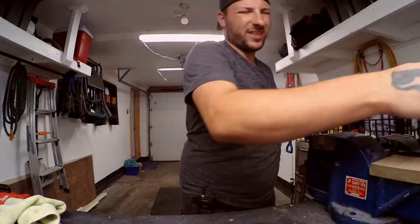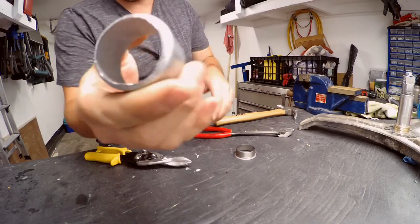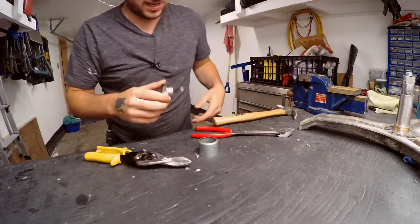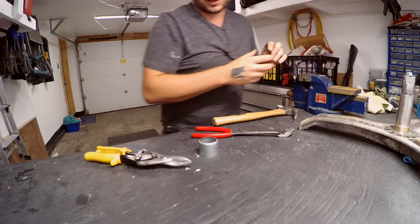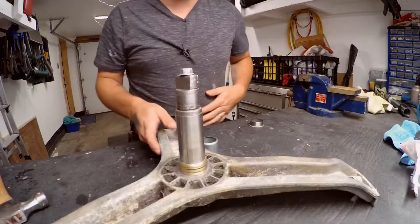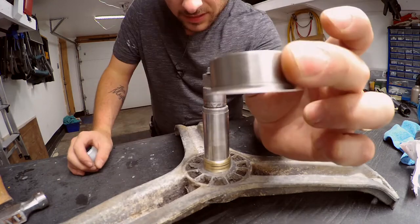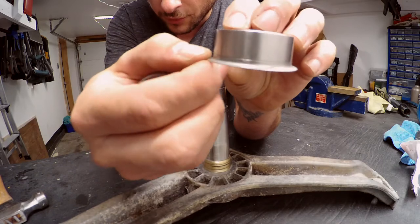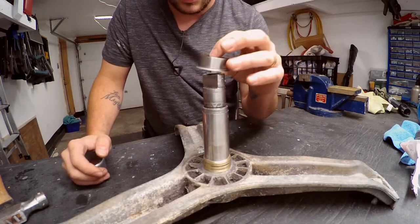That's stinking. Yeah, that's not enough to go on there yet — it's gonna be a long way to file. So we've arrived at the moment of truth. This was the only size speedy sleeve they had that would fit, and it's not really that close. We're gonna find out if it's close enough. When you're installing a speedy sleeve, you want to put it this side down. You'll notice it's grooved on one end so you can take it off after installation with a pair of side cutters — but I'm not gonna be doing that.